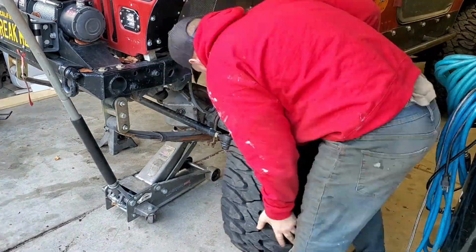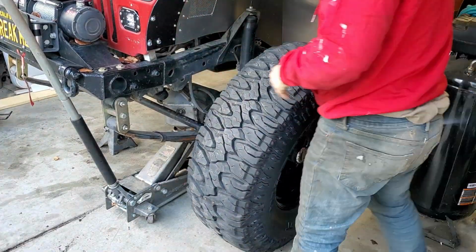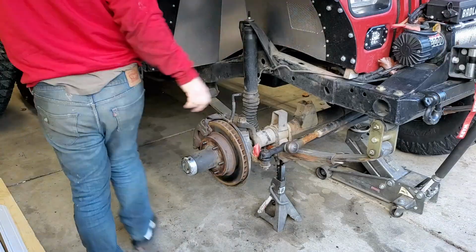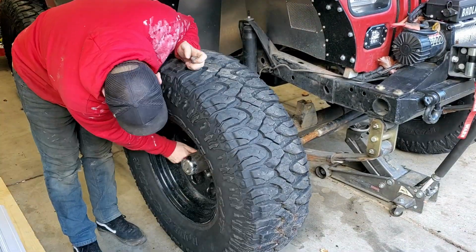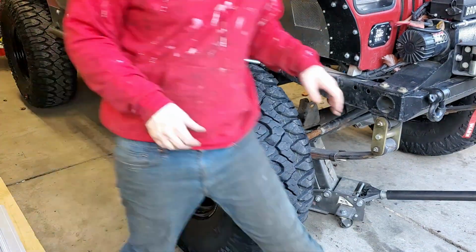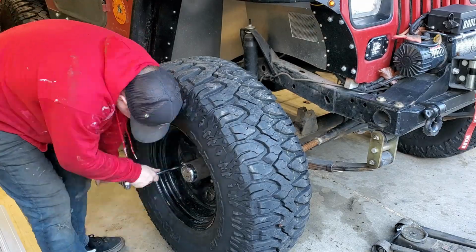One thing I wanted to be crystal clear on is the camber, the positive camber that I'm looking into. That is not something you can fix with the alignment tool. The alignment tool is strictly for toe in, toe out. To fix this positive camber issue, what I actually need is a new ball joint or an angled ball joint if I decide to go that route. Who knows, maybe I'll just keep it like this. We'll see how everything wears.